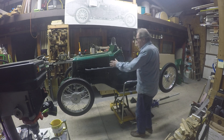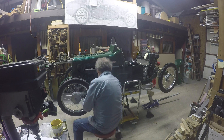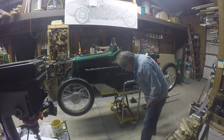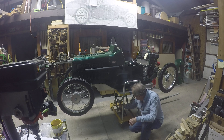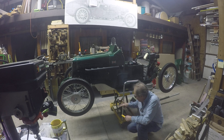We're 30 inches in the air now, so it's really easy to work on everything. You can sit down, work on the wheels, the suspension — everything's really easy to get at like this. As far as safety goes, it comes with these safety stops which hinge off of here and go down. The problem with these short ones is it only allows you to safely stop it at about this height. Anything above there, it can creep down in case the hydraulic cylinder bleeds down — and overnight it will probably bleed down.